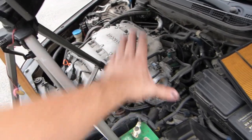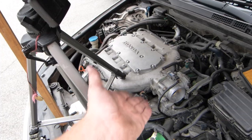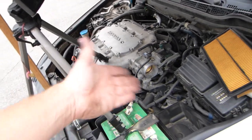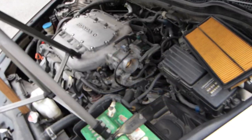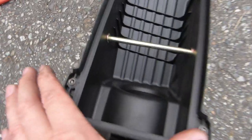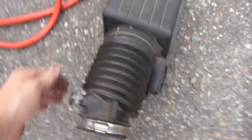It depends where you operate the vehicle. In a desert, it can permanently, irreversibly destroy the engine, needing an engine replacement or rebuild in just a few months. If it's a different climate, I don't know. So the air filter needs to be fitted properly back and seated well, so that's, I hope, crystal clear.